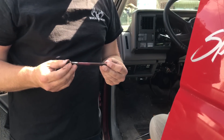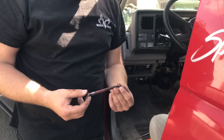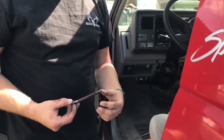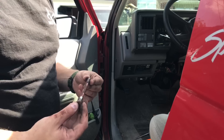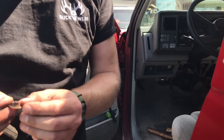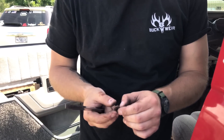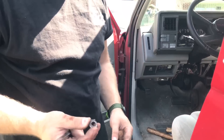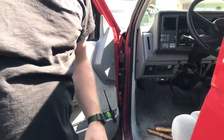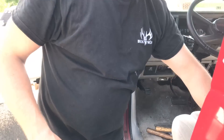There's our pin. Luckily enough for us, the pin doesn't appear to be worn out — it is bent though, so that tells me this door has been over-extended a time or two. The no-wear on the pin means there's more than likely no steel-on-steel, which means it hasn't ruined our hinge yet. But as you'll see, when I get the bushings out they are broken and cracked and worn out. We've gotten the top bushing out — it's broken. The top of it is worn out from where the hinge was riding on it. We'll get to the bottom one now. It's a little broken and it's worn out.